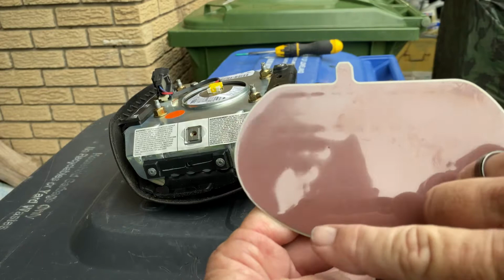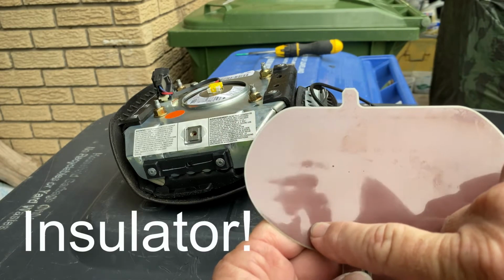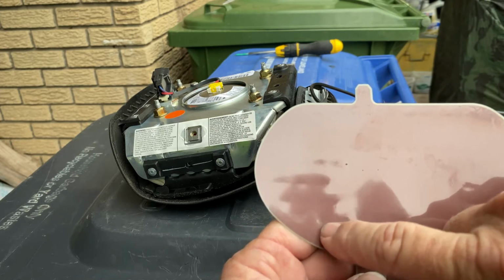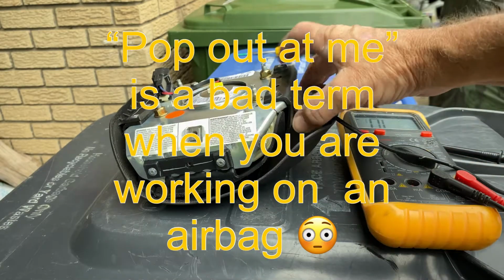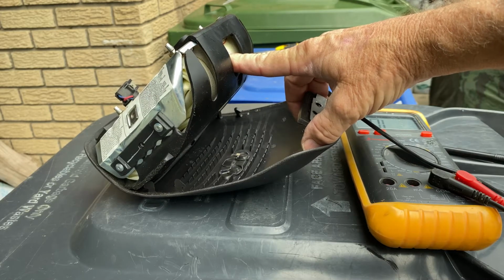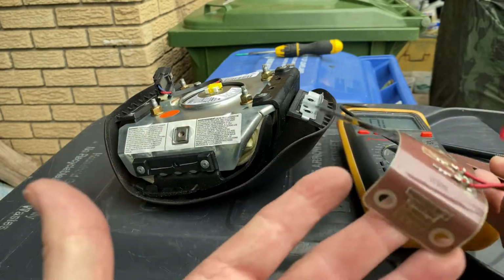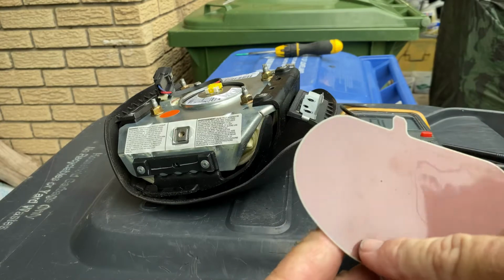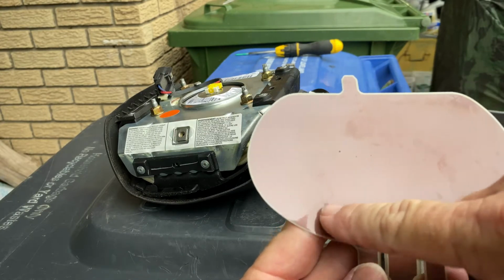My thinking on this is these plates are so close together through the holes in the mylar that just the lightest little bit of pressure from the horn button is pushing it. So there are two things I can do. One, I can shorten the nubs inside here, so they won't be making contact with it. And what I'm going to try to do, rather than buy this thing for $100 and whatever dollars it is, is put a little heat on it with a heat gun and see if I can take that one main dimple.